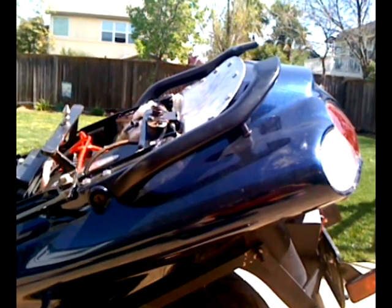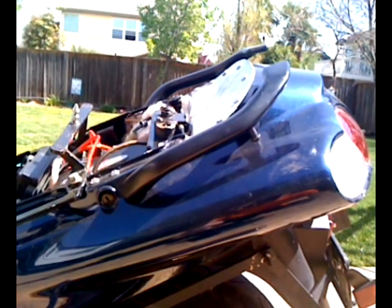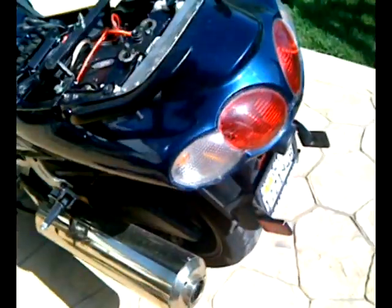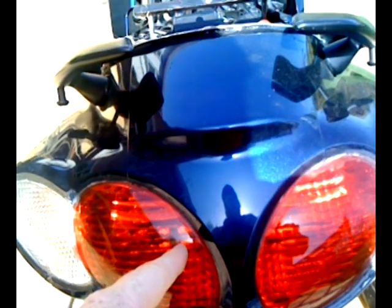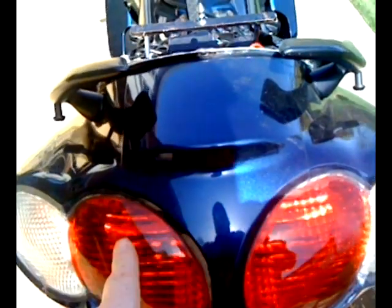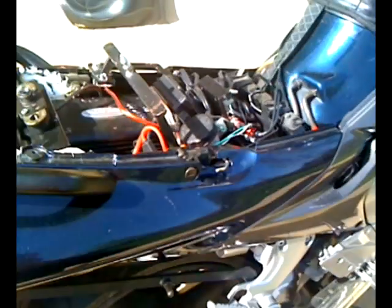The tail piece actually becomes pretty useful when it's got that much airspace. You can see the hump on the back — there's actually a speaker sitting down this way facing down onto the aluminum with a one-inch standoff, so sound gets out. The airspace from about here all the way back is about 0.275 of a cubic foot — a little over the bare minimum for the speaker. There's an 8-inch woofer in there. I cut little holes about an inch-and-a-half by an inch-and-a-half on the inside to let the air space reach the speaker, then sealed it so it's airtight.